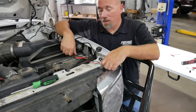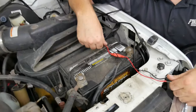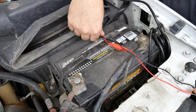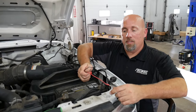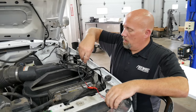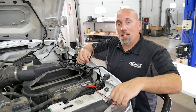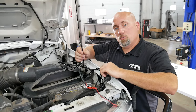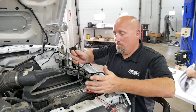This battery is actually fairly clean with no corrosion, which will make connecting everything easy. We're going to leave the wires disconnected from the battery for now, because it's a good idea to do that while running wire through the firewall — so you're not going to short anything out, pop your fuse, or anything crazy.